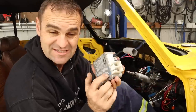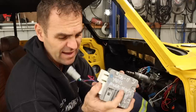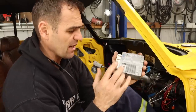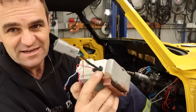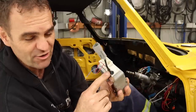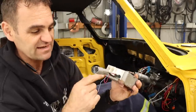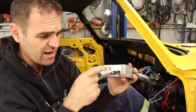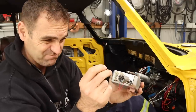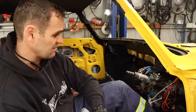This is the control unit for the Yaris electric power steering. You need to run the brain for the power steering, but it has a limp mode which is basically what I'm going to use — it gives a set mild assistance. I got this unit by itself from a wrecker and didn't have the plugs, so I actually found an old car stereo plug with pins in similar-ish locations, trimmed it up and made it fit. It just needs big power in and ground, and a 12-volt ignition source — very simple.